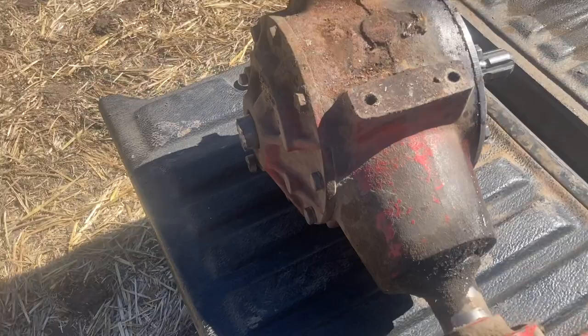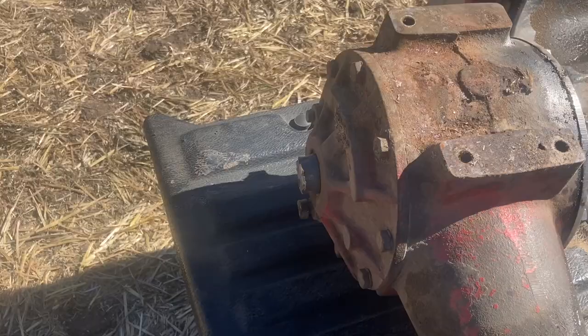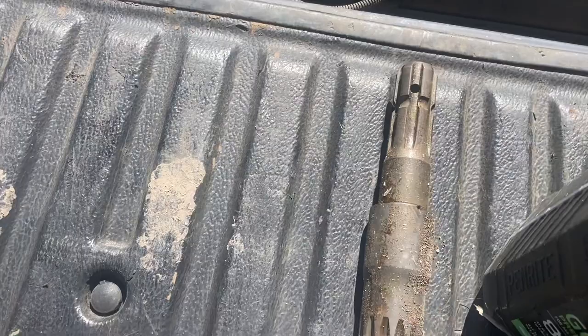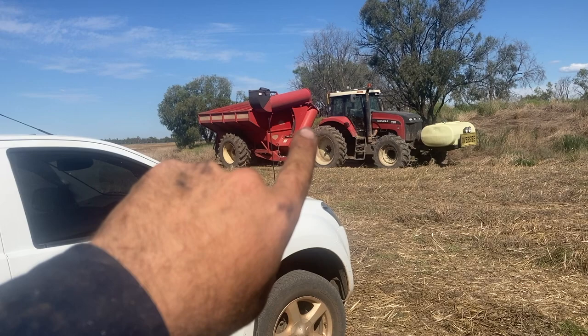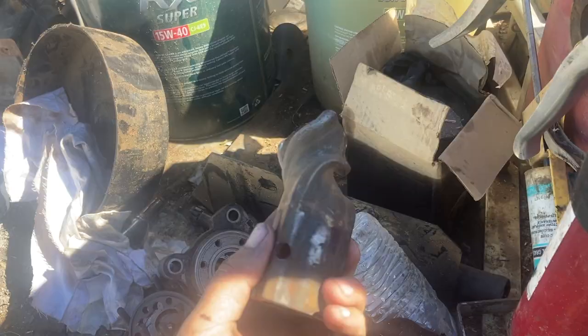The little red chaser has got its own issues - the shaft has snapped off. Because it's such a big auger this drives, we have had this shaft snap before and we're usually very careful to make sure we don't start it with any grain in the auger, because if there's a heap of grain in the auger and you kick it into gear it puts a lot of stress on these shafts. We do have a spare one - last time we did one we ordered another shaft as spare. What happened when it failed was the upright auger stopped but the cross auger in the bottom kept going, jammed itself up, and for some reason the dog clutch didn't release - it twisted the PTO shaft quite substantially.